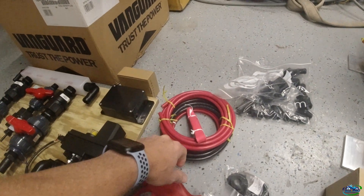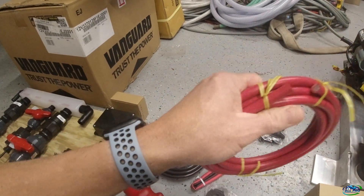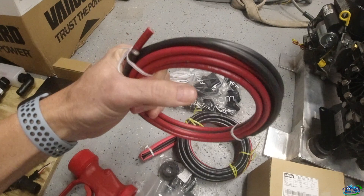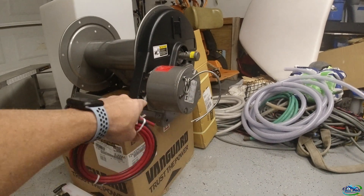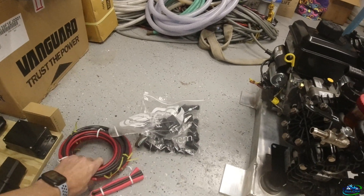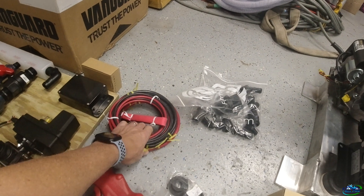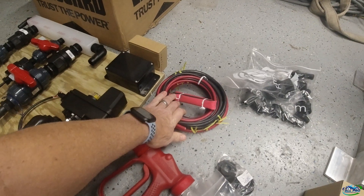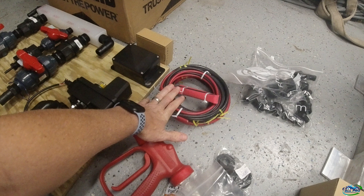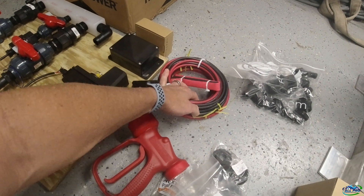For battery cables, I always go with marine-grade 10-gauge cable. I got some positive for the battery to hook up to the starter — red and black — and also some 8-gauge because I'm going to daisy-chain the reel to the other reel. I'll put a lug on it, do it right, and I got the shrink wrap for the cables too. This is from Battery Cables USA, out of Ohio. They beat the price of any local marine company, reasonable shipping, sent via mail, good product — I've used it many times.